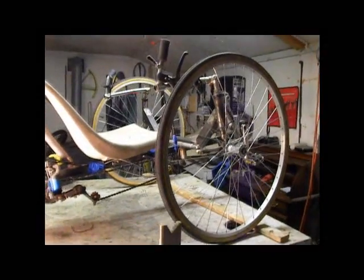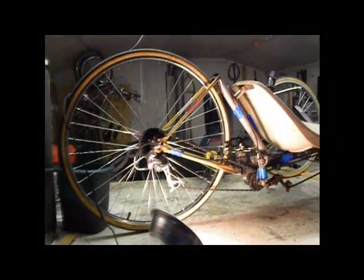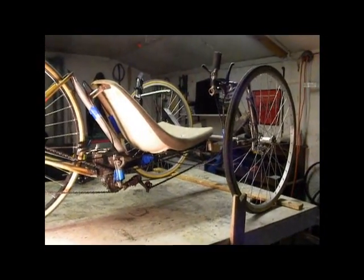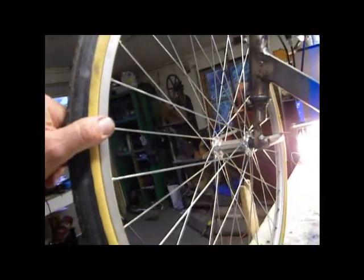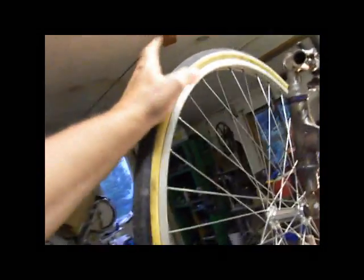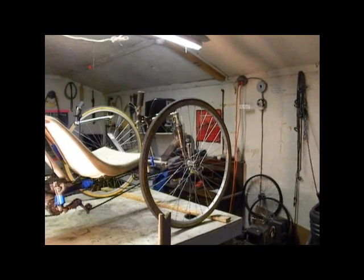Now I've had this out on the road and put about 20 miles on it, and I've noticed a couple of things about it. It rolls extremely smooth and easy and low, and it's nice riding, but it's got some really junky tires. I bought these off the internet. I'm trying to look to see who they're made by. Oh, here we go. Kenda. But anyway, they were $9 a tire, and they're not round, and they're thicker in some spots than others. Because they're thick in some spots and thin in others, and out of round, if I let go of the steering at high speed, it'll shimmy.